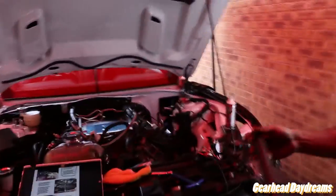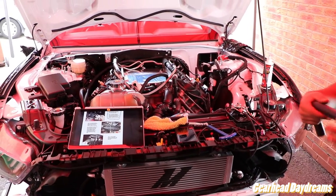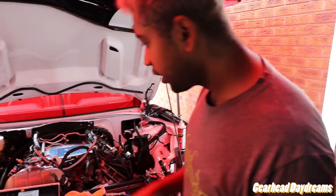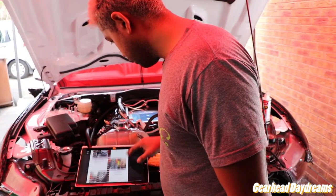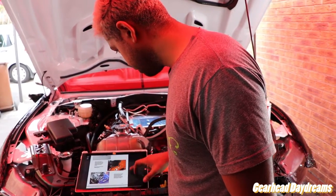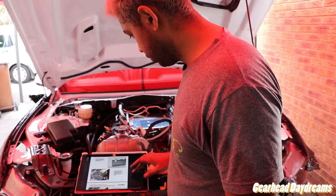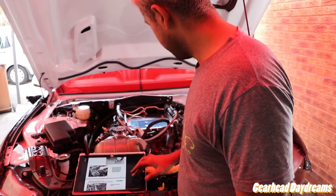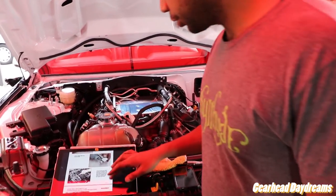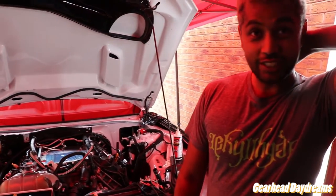Next up is just to finalize the water pump assembly down there. And then it's the wiring. So the wiring is a bit of a nightmare. So a lot of soldering, a lot of heating. We have to take this apart. Once we've done that, we have to put the reservoir on, and we've changed the spark plugs and the injectors already. We've already done this bit, and we're modifying the valve cover as well, and then the supercharger goes on. So we are within touching distance.